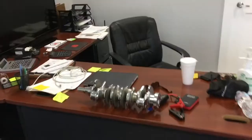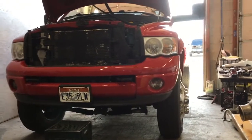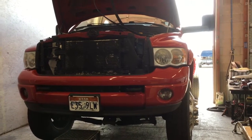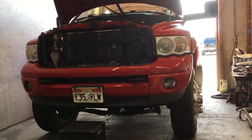You'll also need a new accumulator with O-rings and springs, and the PAG oil that goes in there. We're going to have to pull a vacuum on it and let it sit. In a couple weeks I'll get the AC repaired, but until then I can run it with the AC bypass using that $35 belt - and when I pull it off, I can keep that belt as a spare. In the future, if a compressor ever goes out again, all I'd really need to get back on the road is a 13-millimeter wrench and a half-inch ratchet to move the tensioner.